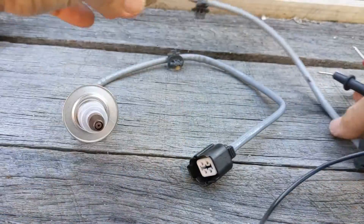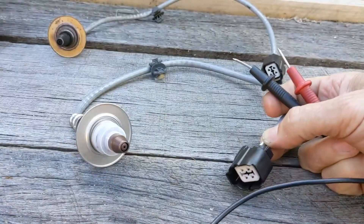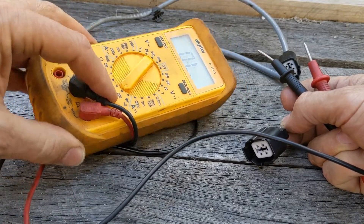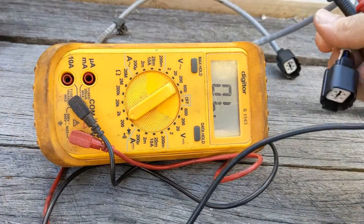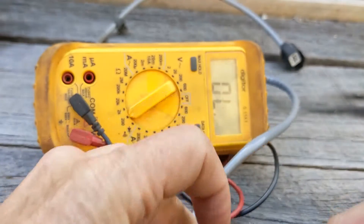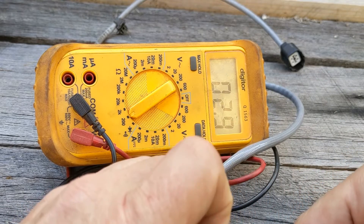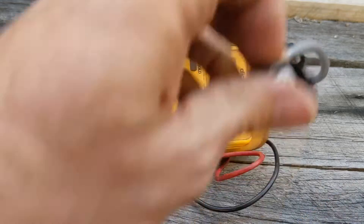What you can do is grab the new sensor. The heater circuit wires are the two black ones. If I grab a multimeter and put it onto the lowest setting for ohms — in this case I've got it on a full scale of 200 ohms — and put my probes across the two black wires, then I get a reading. In this case I've got a reading of 2.7 to 2.8 ohms. That's quite a small amount of resistance, but the fact is it is a positive amount of resistance, and that means there must be a complete circuit for that reading to come up.